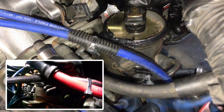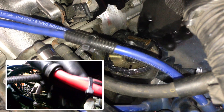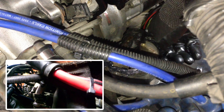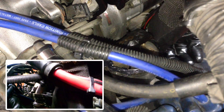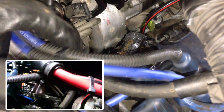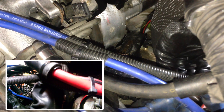So number one — we'll be able to just start it up and then set the timing. Remember when you push distributors in, they're on a tapered gear, so as you push them in the rotor's going to move. You need to allow for that as you push them in. And that's pretty much in the right spot. So we'll just put some bolts in — we're not going to tighten them right up yet because we're going to have to adjust it in a minute.